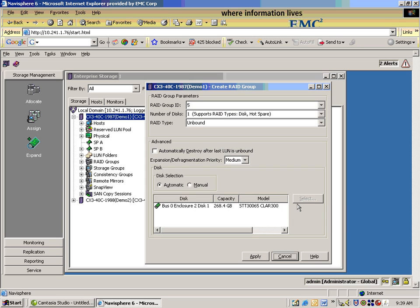Nice. So what about creating a hot spare? According to the Edison report, that takes about 90 seconds. Can you walk us through those steps? Sure. This is going to be doing it from scratch — it's going to be two quick steps. We're going to create a new RAID Group of just one disk and designate the RAID Type as Hot Spare.